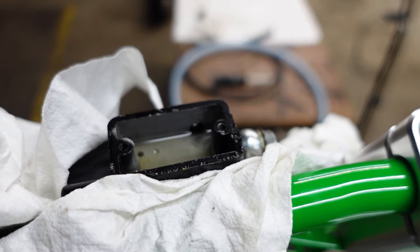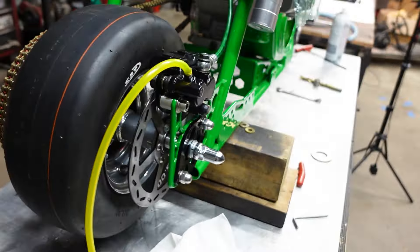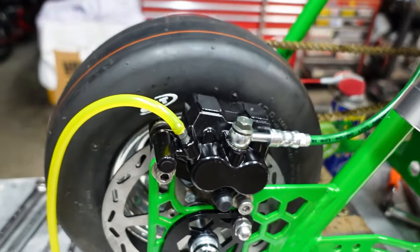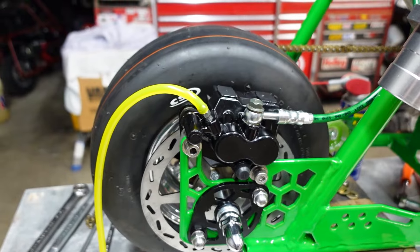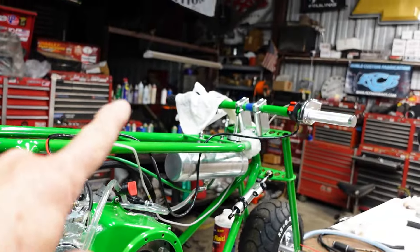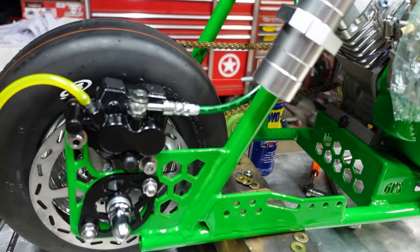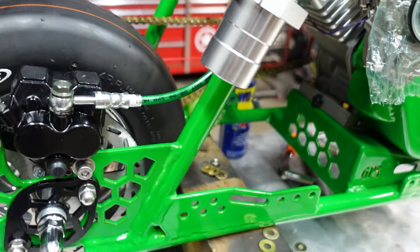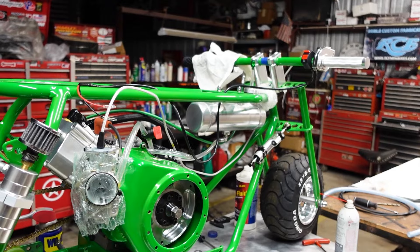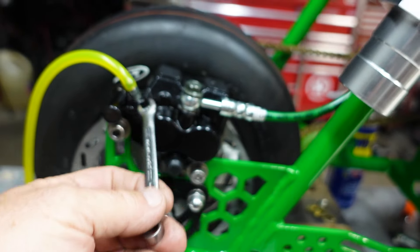This took me a while to get pressure because I had to fill the whole brake line. If you squeeze too hard it'll just blow brake fluid all over your bike. What I did was let the line off at the very back and let it gravity feed — but that's only if you're replacing the whole line or taking everything completely apart. It kind of takes two hands or two people. What you're going to do is pump your lever on the handlebar, get good pressure, then hold it.